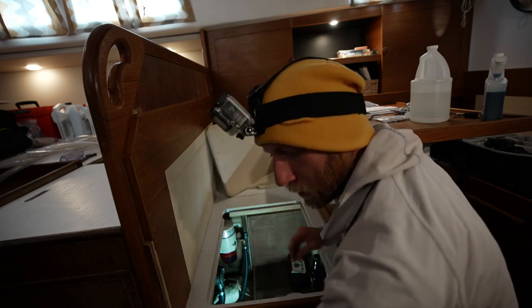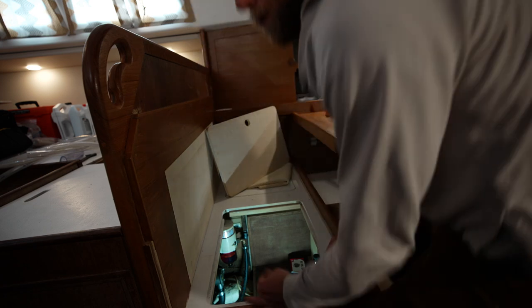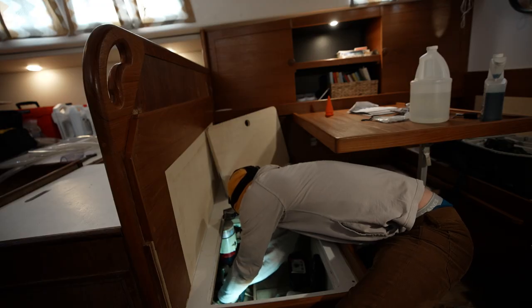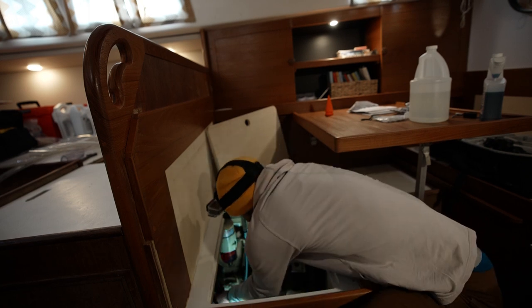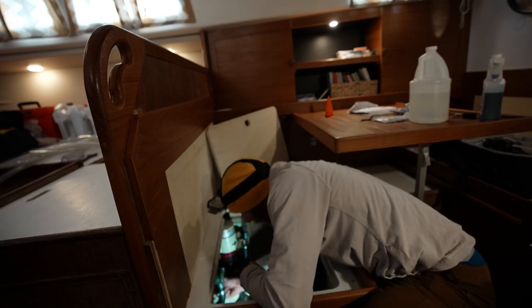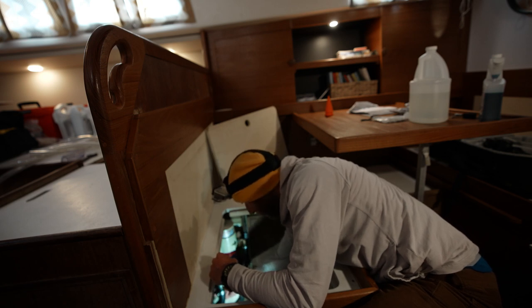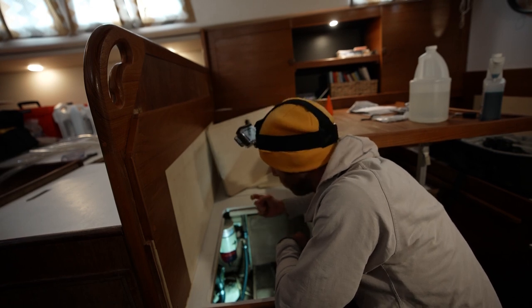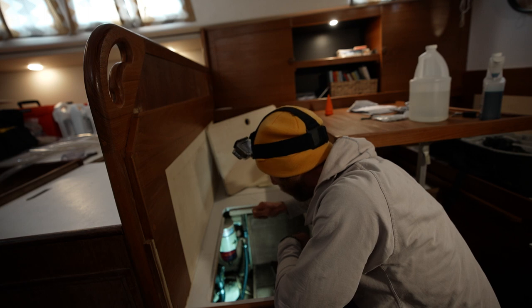This thing is in the worst spot. This hose clamp is in the worst position and I don't know how it got turned this way. Always take this into consideration when installing your hose clamps — make sure that they are tightened down in a position that it's going to be easy to get back to.